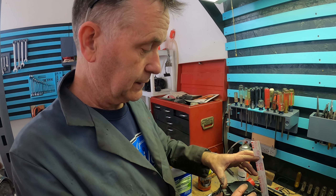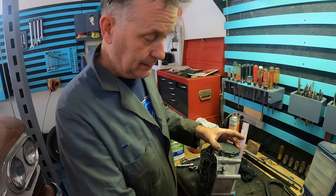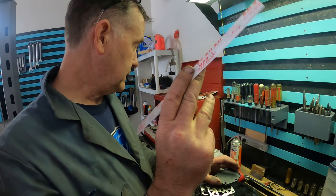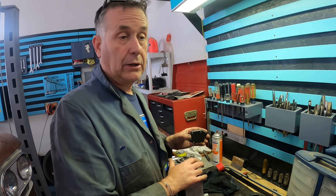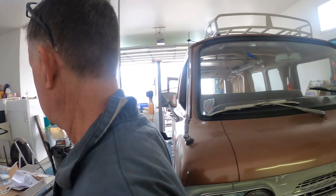Inside this package is a little piece of round, sort of waxy plastic. I'm going to put a piece of it on top of this gear, put the gasket on that I think is the right thickness, and basically assemble and tighten this up. Then I'll take it apart again and look at how much it squished the plastic. You measure the width of the squish and it tells you the clearance. Some of you have probably seen this before — you also use green plastigage to measure main bearing and rod bearing clearances. This one is red.